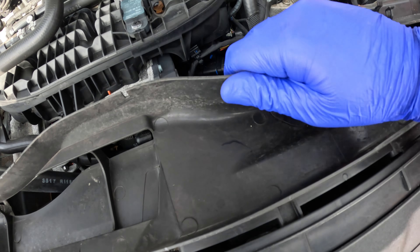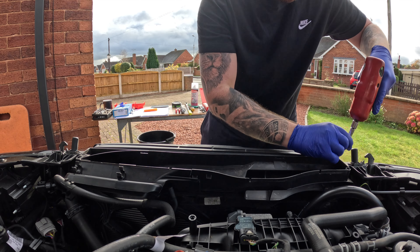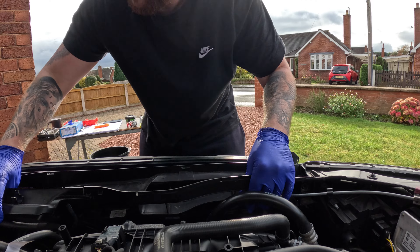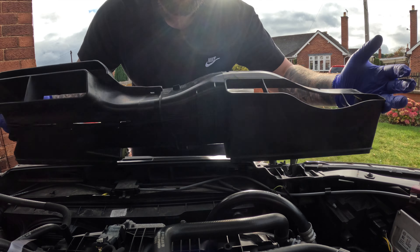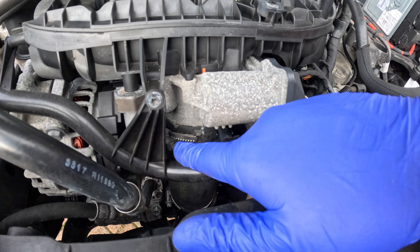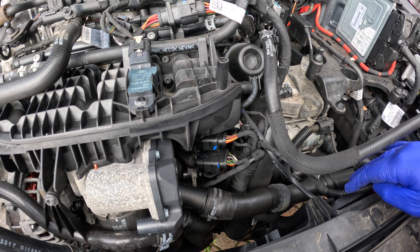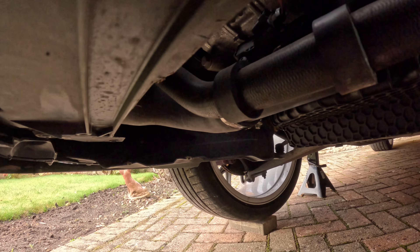Next, remove the air duct — there's a T25 here and a T25 here, plus two little tabs on each side. Lift and push down on those tabs to pop the duct off. Then undo the 7mm on the throttle body pipe and use your pick around the edge to release it from the throttle body, as they can get crusty and stuck together. Then unplug the throttle body plug — pull the tab down first, then slide it out, and move it out of the way. Use the pick to clean the crap out between the pipe and the throttle body.